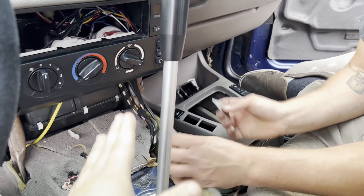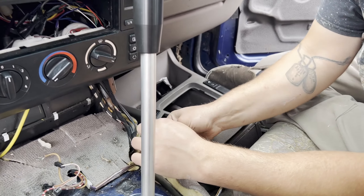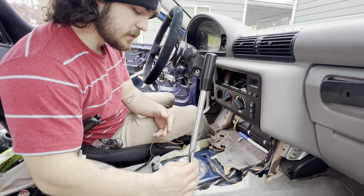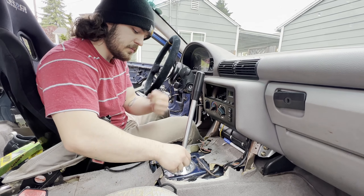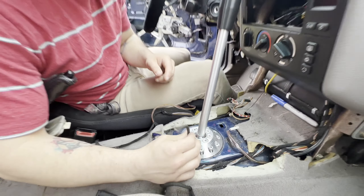So I think we've come to a conclusion. I've decided to stray away from shortening the shifter — I like the length, it's kind of baller and it's a nice grab from the steering wheel. We're going to end up mounting the hydro on the passenger side, which some people consider a big no-no, but you've got to deal with the hand you're dealt. We went to the store and got some hardware. I'm hoping to get the shifter out without going under the car, since once I get the bolts out I should be able to lift the shifter and get the clip off the selector rod, then drill all four holes to mount the bracket.